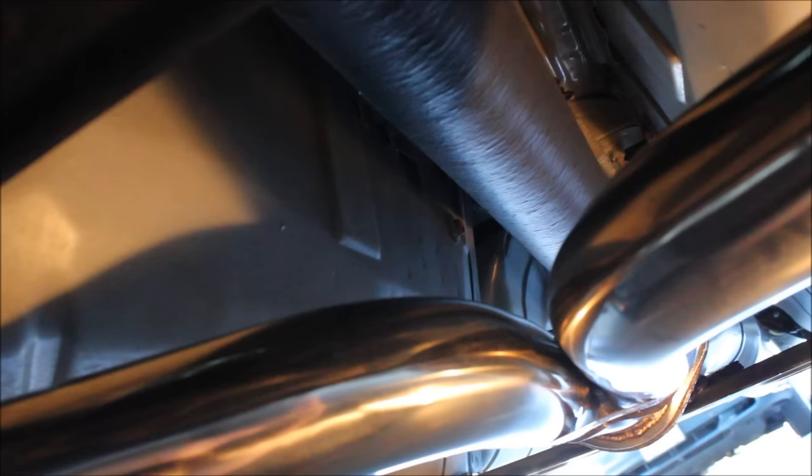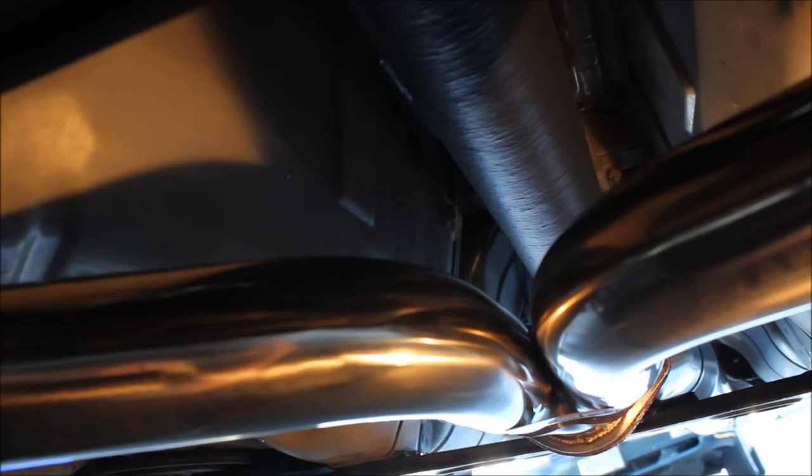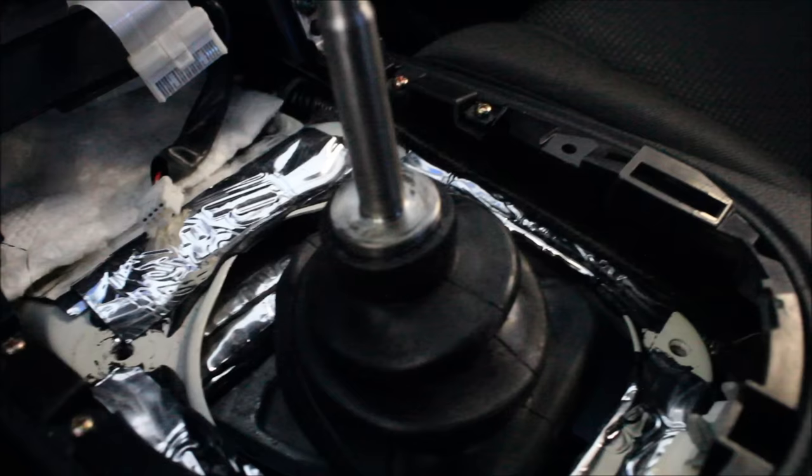Once you're happy with the operation, go ahead and put all your dust shields on. If you're wondering why I have a lot of room under this particular car, it's because I have a Megan Racing Y pipe on here — this is the HR style, which will fit on 2006 and lower cars. You will lose your little bottom deflectors, but I think it's a small price to pay. A lot of people complain about Megan Racing fitment, but this thing just bolted right up. What people do have issues with is if you're running high flow cats — I am not. There are these hangers here, and I would recommend getting it done at an exhaust shop so your Y pipe doesn't drop down so low. I'll still eventually do high flow cats, but I recommend going the HR style because you gain a lot of access, and there's a reason why Nissan switched over to this style when they redid their exhaust system.